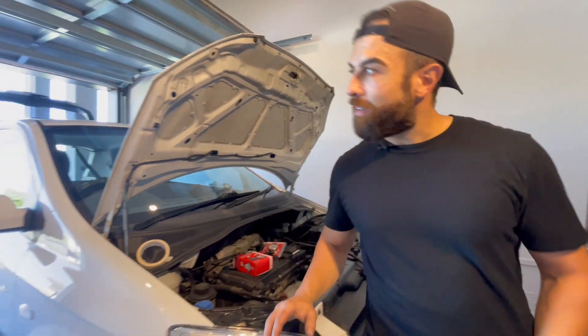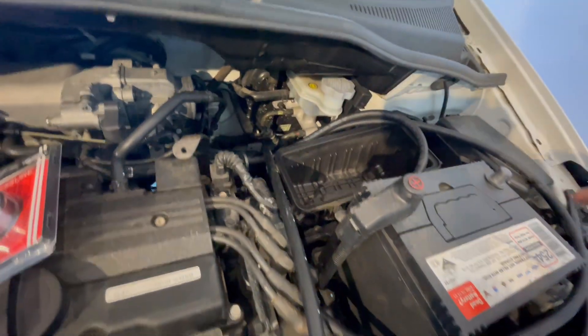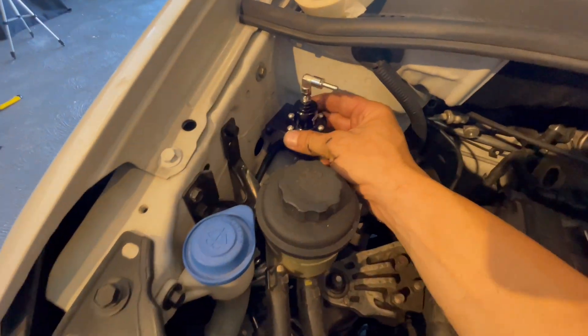So where to fit this — I've been looking at the engine bay, beauty is in the eye of the beholder. I could put it somewhere here but the air box goes too high, so I'm thinking of adding another 400mm on the fuel hose and going here. Some might disagree, but at least in the future if I need to return the car to stock, the fuel system has to stay regardless. I don't want to block the air filter location — that's just my thinking.